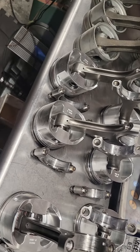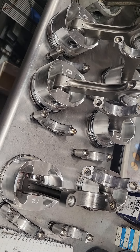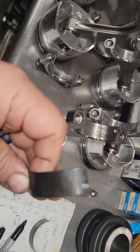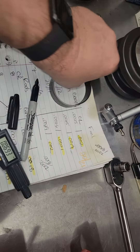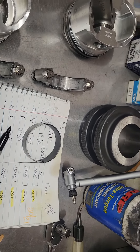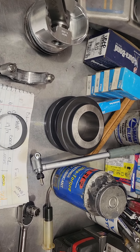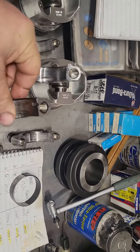These were a P bearing — a passenger car bearing — still on a performance scale. These new ones are H bearings. They're old school; I'm not sure if they're still available. They're identical width-wise, so we won't have any chamfering issues. I could step up to a 720-series — whatever the wider one is — but that would require chamfering.